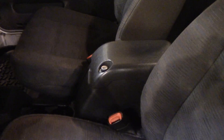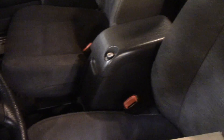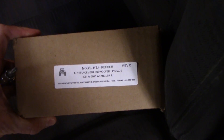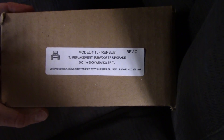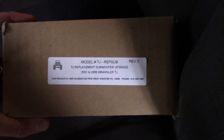I'm going to be showing you in this video how to remove and replace that subwoofer. There are a few different options: you can go with an aftermarket subwoofer which will require some modifications and possibly making a custom bracket to make it fit, or you can do what I did and order from Crawdotech — you can also get this on eBay. It's the actual factory replacement-style subwoofer. It is not a Mopar product; it's an aftermarket one that's actually been made better with some of the weaknesses of the factory sub corrected.